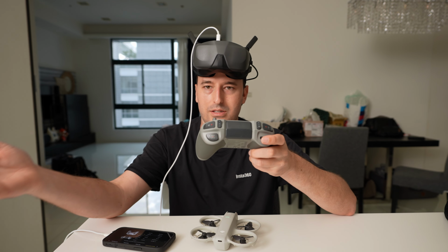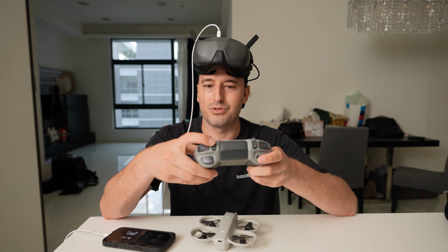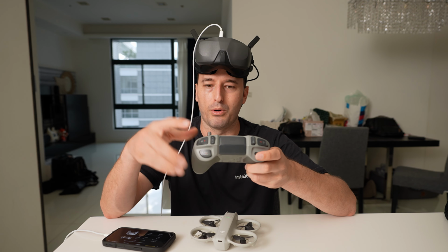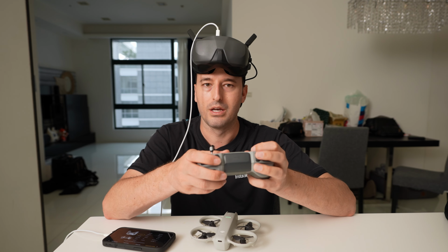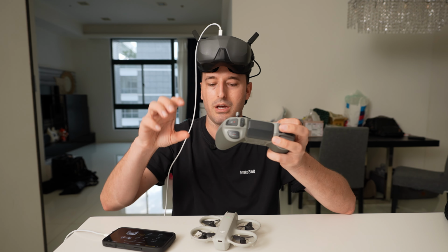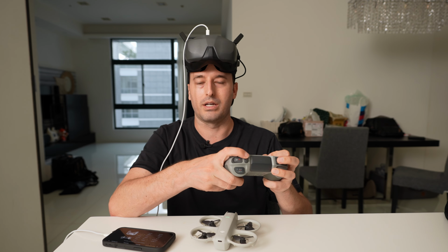And then as I am ready to land the drone or maybe catch the drone, do that cool trick, all I have to do is push back on that switch right there. There's 2 levels. It will cut at both levels. So the mid, that will cut the motors. This just makes it so that you can very quickly and aggressively kill the switch. So it's coming, it's coming, it's coming, you're landing it and kill and grab. And you're about to land on this spot that you want right here and kill and land.